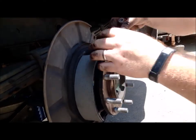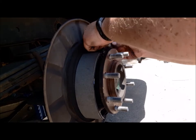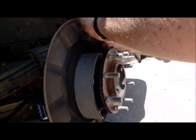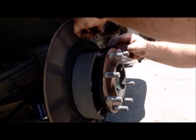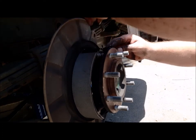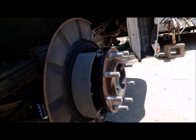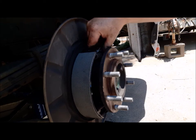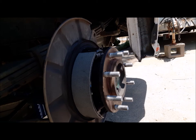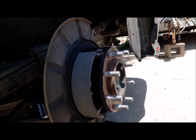Okay. There's a spring. Hooks on both sides. Before I do that, I put the adjuster in here. The adjuster, spin it to both sides, lock in, you put the spring in, boom. It's just like the other side. So it's loose, and we're gonna tighten this up, and let's go get the rotor, and then put it back on.